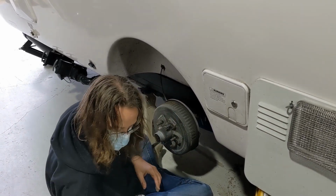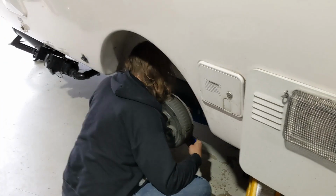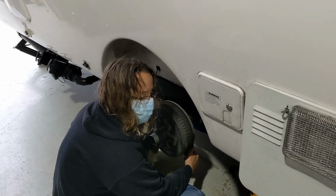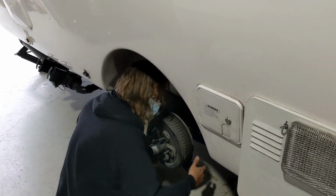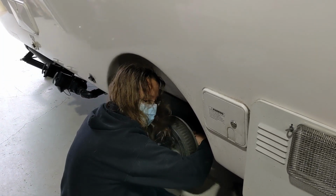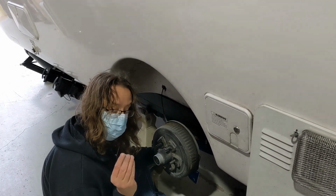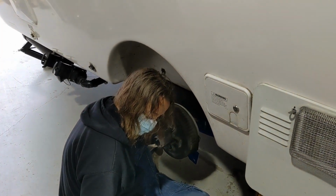So is the cinch nut better? Well, that's a good question. Before we put this on, whether or not those nuts were loose or tight made no difference whatsoever. Now they do. So now we don't want them to be loose, so we use these cinch nuts. There's going to be a couple of threads that don't bury themselves into the nut, and so you get a nice strong nut and you still get the locking effect. So that's why we use it.